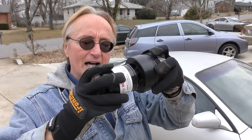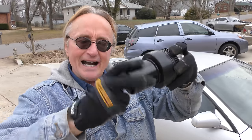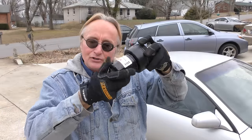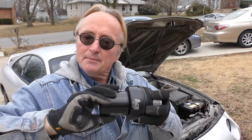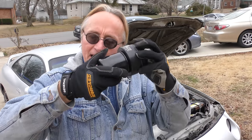Once this Baxter adapter is in, all that's sticking out is what you're normally going to see. Then you get a regular Toyota filter, and voila — it just screws right on. So when you change your oil, you just screw it off. And of course as a tip, always lubricate the rubber gasket on your oil filter before you screw it on. That way it will stay nice and sealed because the oil lubricates it and makes it set right.